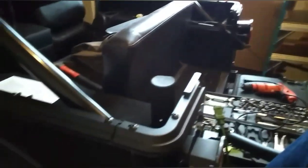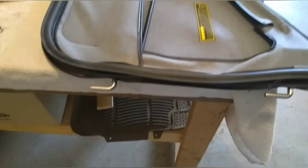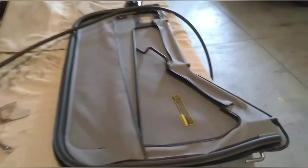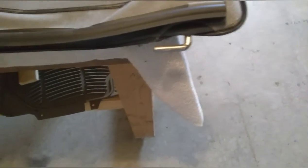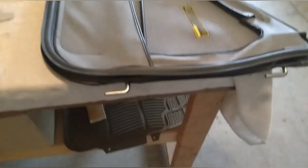I still got to do the doors. I test fitted one and they didn't really slide down in there — I think it's because of the powder coating. I want to have a little rant about these Best Top doors: love the door, love the built-in handle, love how everything's powder coated, and everything else on the Jeep fit perfect. But these pins were powder coated and just way too big to go down into the hinges. I've had to take my DA and grind them down so they'll even fit, and it's still super tight. I suspect if I had a YJ it probably would have popped right in — I think this top is more geared to the YJ. But a little extra work and we'll have them mounted.